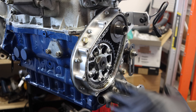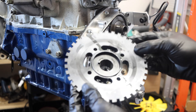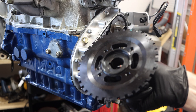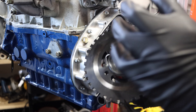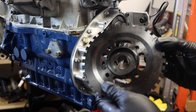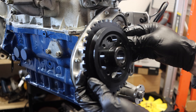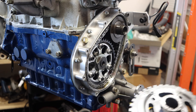Before we get into this, one thing I want to show you is that this management pulley is from MED — it's brand new. It can be run with or without a damper. On the early Cooper S engines these didn't have any harmonic balancer, but in my case I'm definitely going to run a harmonic balancer to reduce engine vibrations as much as I can. You can see this has a V-belt pulley on it — really, really nice piece of kit from MED.